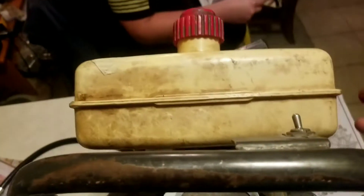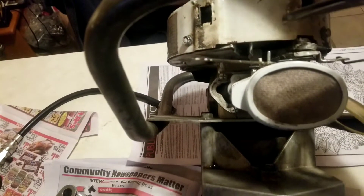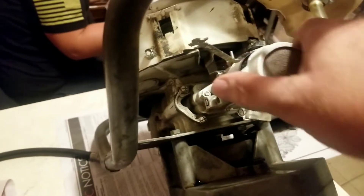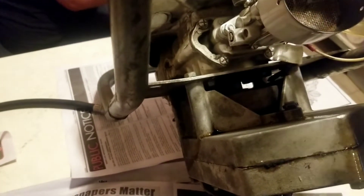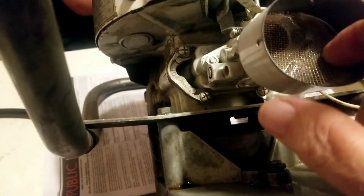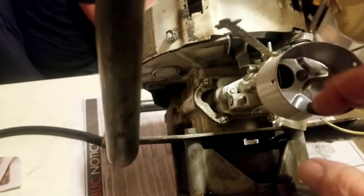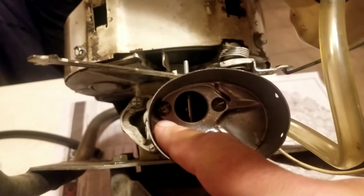For a little extra room, you can grasp the fuel tank and wiggle it upward — it comes right off. Then snap off the air cleaner cover; it just snaps off. We can clean the filter pad with some carburetor cleaner or gasoline, same with the foam filter block. The inside also has a screen that should be cleaned — there's quite a bit of dust and debris in there.